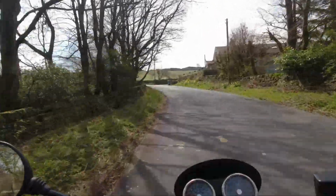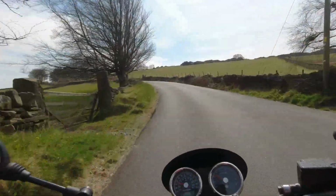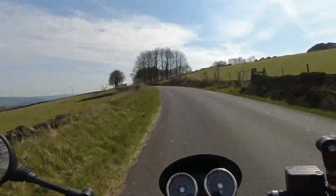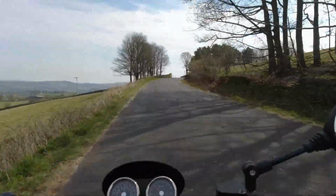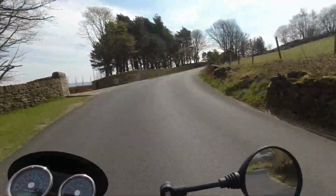I think they're just a touch on the loud side, but they're dead simple to pull in pieces and increase the packing if you wish. I might even look into that. I did do it on my wife's, who's got the same, only single silencer on her bike, so I changed some of the baffling a bit, welded in some extra bits, put some extra packing in, etc. So might look at doing a little bit of that.